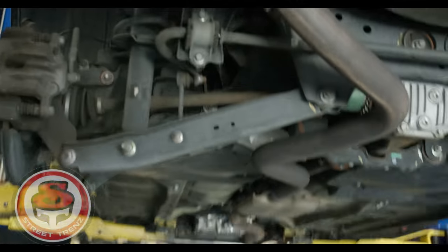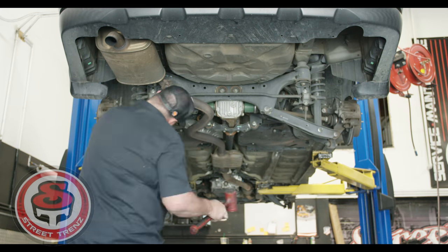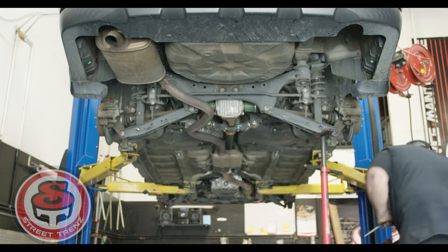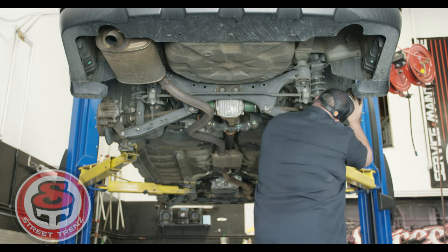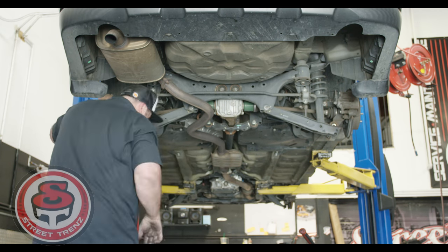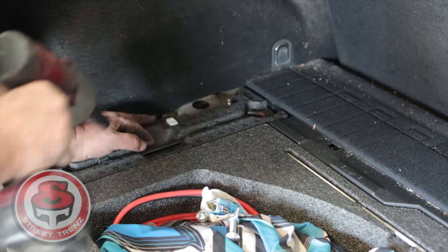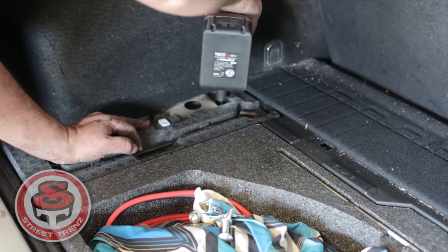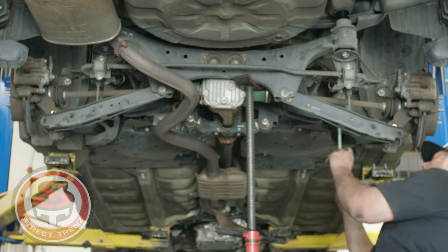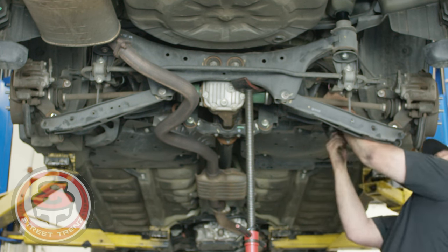Here's just a quick look at the all-wheel drive back end. He's loosening up everything so the strut can drop out — he has to loosen all these bolts. He took a little bit of time but the back didn't seem as hard as the front. He opens up the trunk compartment where there are two screws on top, loosens those up, takes off the bolts, and it drops down. There are three spacers in the rear, which helped so the camber wasn't that far off.